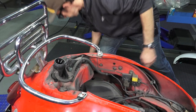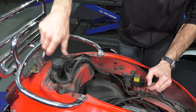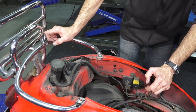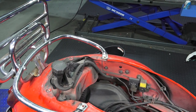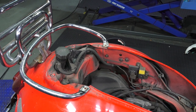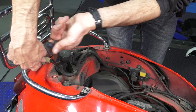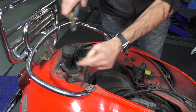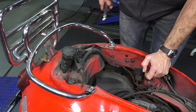That all lifts out. Recommend putting the fuel cap back in for right now. Always want to do this with a low tank if possible. You have a vapor line going to the top filler neck — you can use diagonal pliers to cut the hose clamp off, but sometimes you can just slip it off. These tanks are all plastic, which is great because they don't corrode. There are no barbs on it so it usually comes right off and you can push it back on without issues.